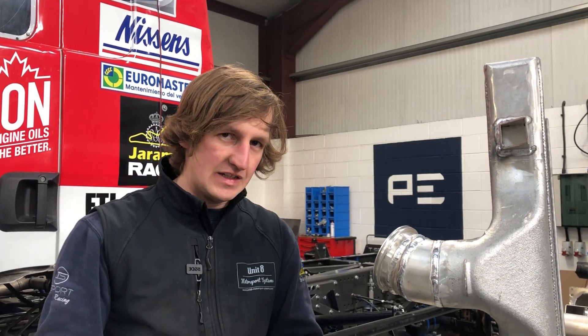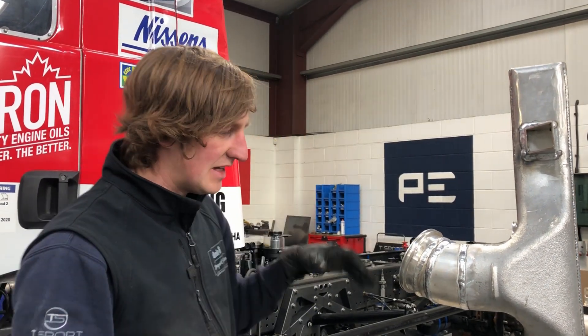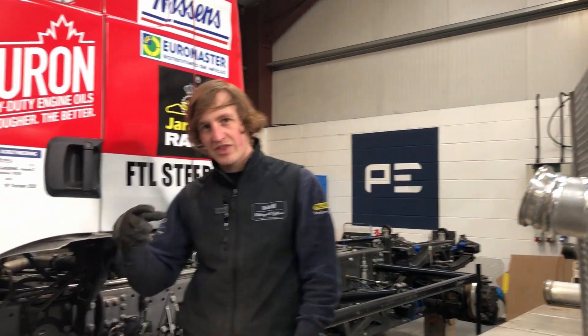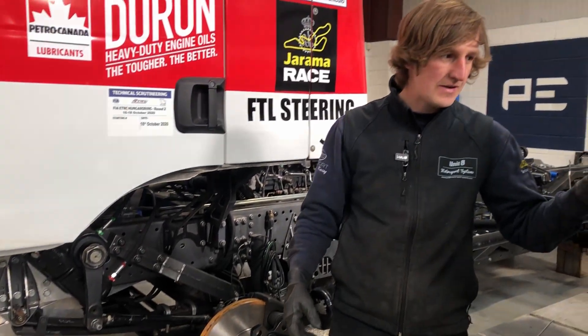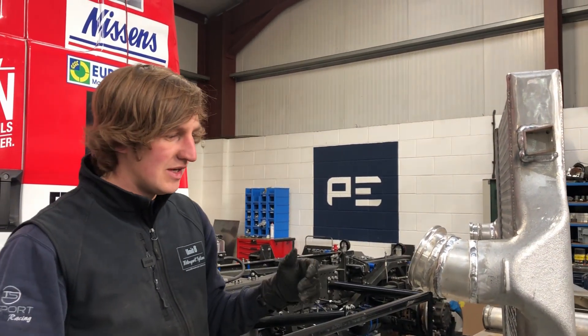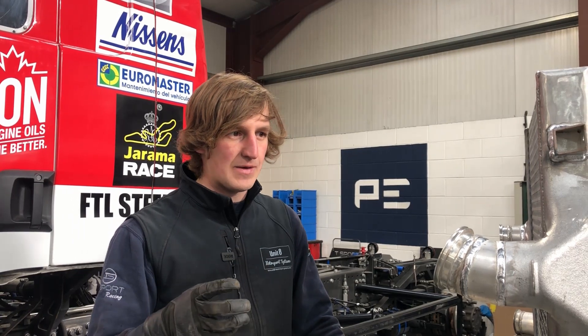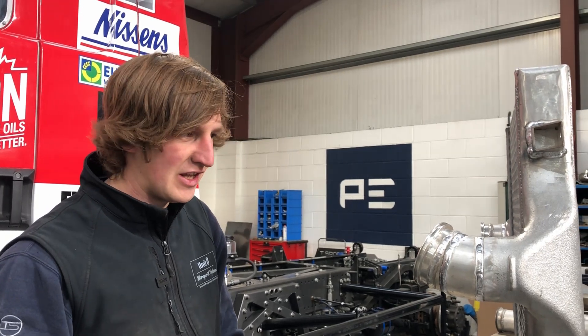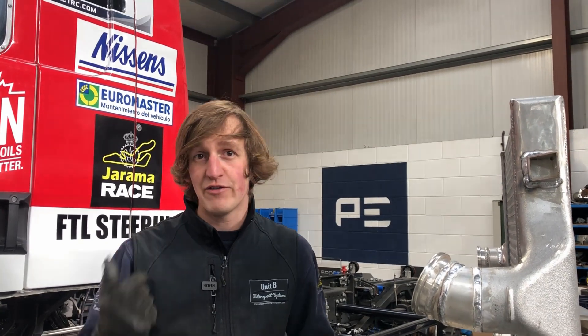The radiator we modify slightly — on a standard one we have water in, water out, but also a bleed pipe so it can self-bleed; we actually blank that off because we don't need it. With the intercooler we have some nozzles because we cool the brake discs down with water through the vents, and with that same water we actually spray onto the intercooler to cool the charge temperature down even more. On a 30 or 26 degree day we'll try to be around 18 degrees Celsius with the air going into the engine, and obviously the turbo creates a lot of heat which is the benefit of an intercooler even on a standard vehicle. Thanks for watching — don't forget to check out our other videos and give it a thumbs up.